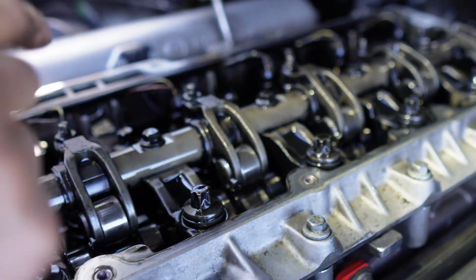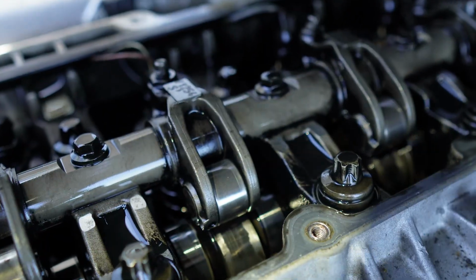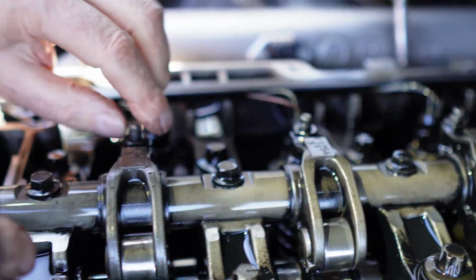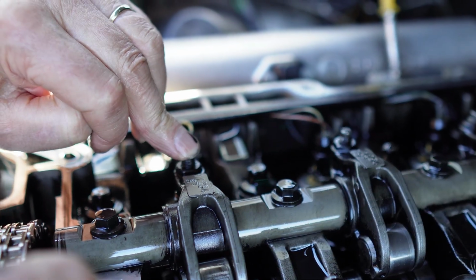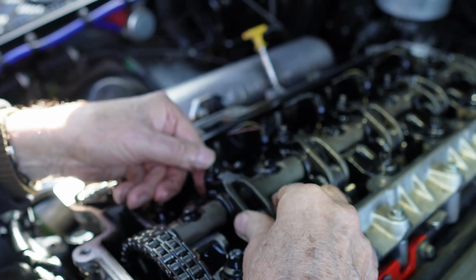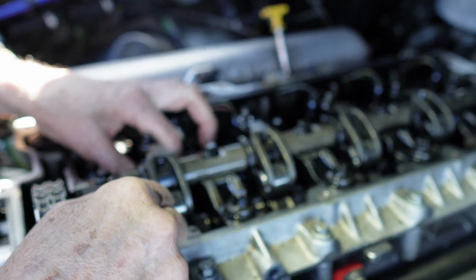Then you got to have them on the back of the cam, which this one is near enough on the back of the cam. So this one means that is right up. Yeah. And you should slacken that nut off, and that should only go down 1 turn. Right. So that's to adjust them, I take it, is it? Yeah, because there should be a little bit of slack in that when it's in that position against the spring. Right. Okay.